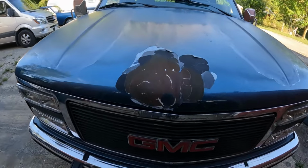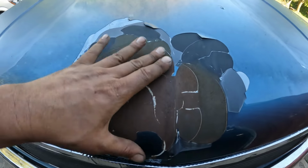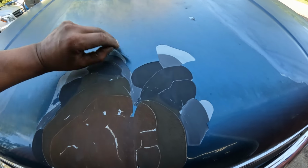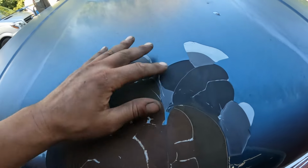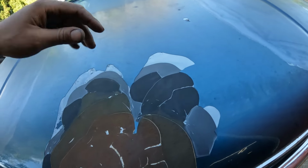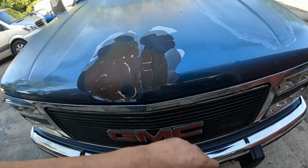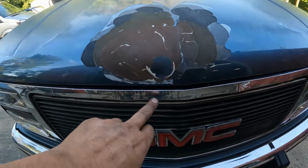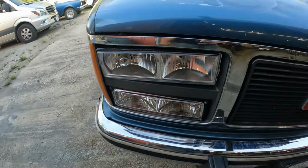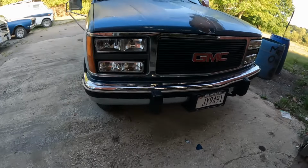Here's what she's gonna start sanding. Just a small dent here. This is basically where it got hit and the paint cracked around it and kinda snowballed out. So unfortunately, it's coming up pretty good now. Lots of coats on this thing. So we'll knock that down and kinda feather it in as far as we can, hopefully. It's gonna get worse before it gets better. And eventually we'll get around to doing a repop grill, because the plastic chrome's flaking off there, but pretty happy on these headlights. We'll see what it looks like a little bit later.